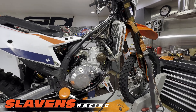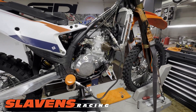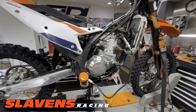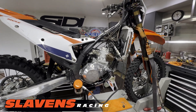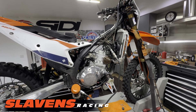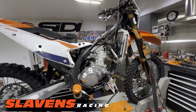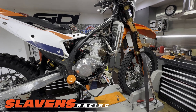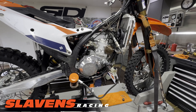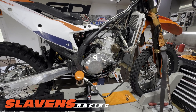First of all, you want to make sure you've got a good quality gauge. This one is a Snap-on. You don't need to spend four or five hundred dollars on a Snap-on gauge, but you definitely don't want to go to Harbor Freight for a compression gauge either. You need to find something that's decent quality. We've got Motion Pro ones and Bike Master ones on our website and those both work well. This is not a time to cheap out — if you want a good compression reading, you need a good quality gauge.